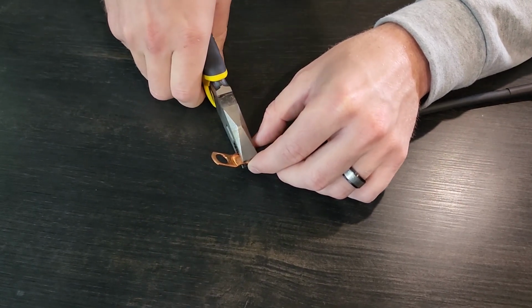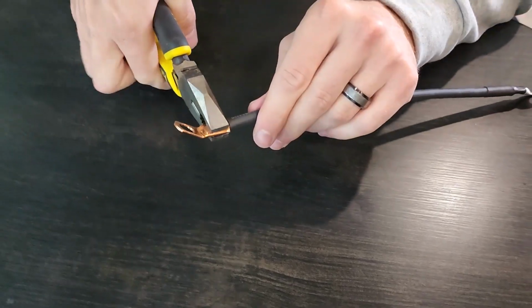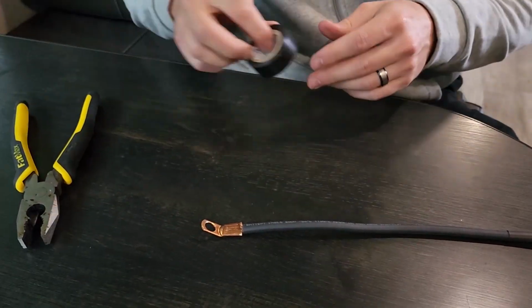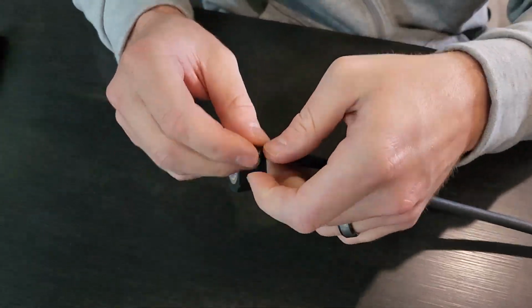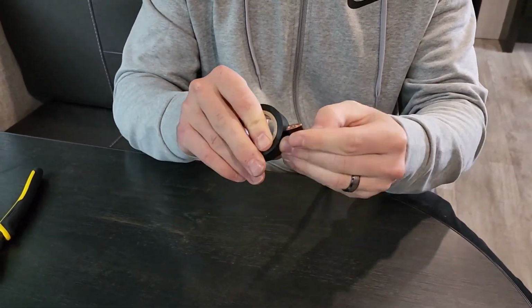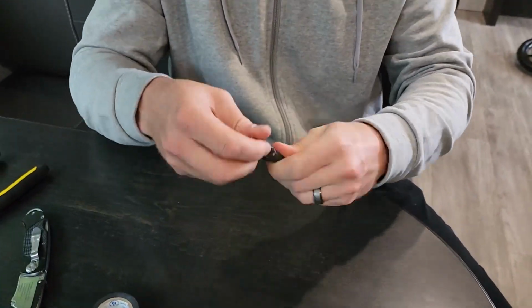The first step is connecting an inverter wire from the battery to the switch. So we have to get that prepared. The inverter wire that I bought, the lug at the end, that metal piece that attaches to the switch, was not big enough. So I had to buy a bigger lug, take the old lug off, attach this one, press it down, and apply some electric tape. You may not need to do this, but this was a step that I wanted to show you guys just in case your lug does not fit the switch that was bought.